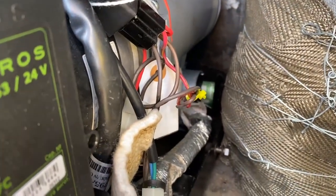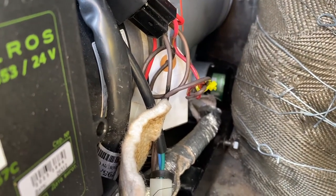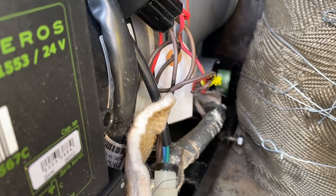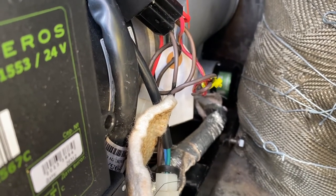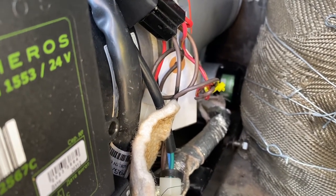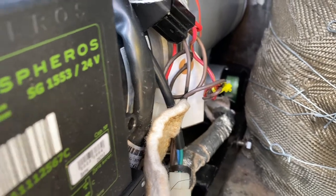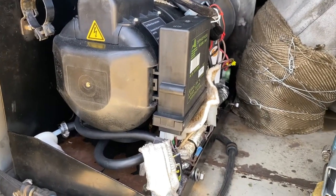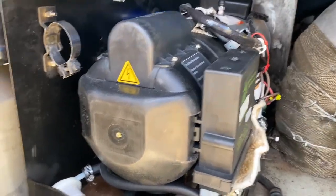The unit is firing up. The coolant pump on this one is an older coolant pump — it's a U-4810. Again, that pump cannot draw coolant; it uses the head pressure of the tank. The unit is cycling right now and I'm doing a bunch of checks.